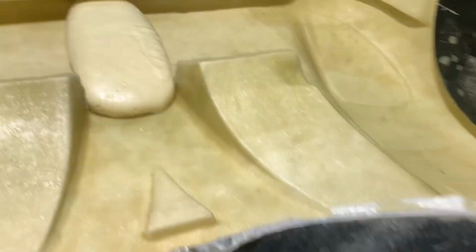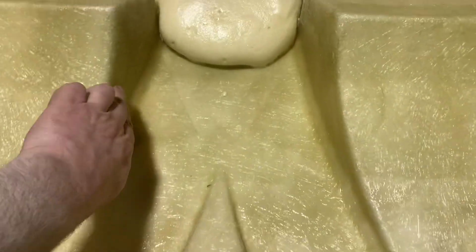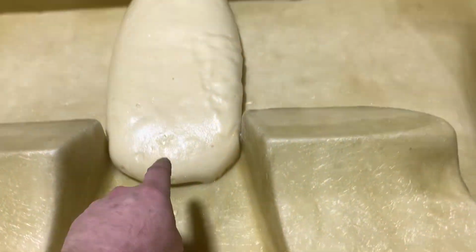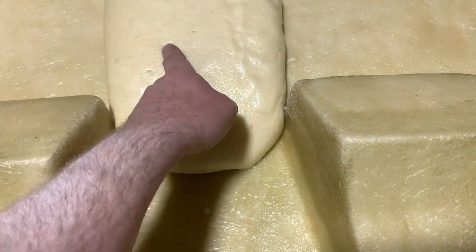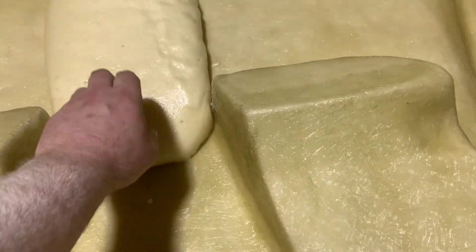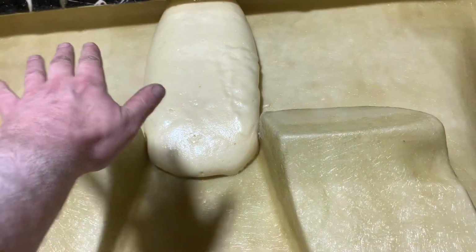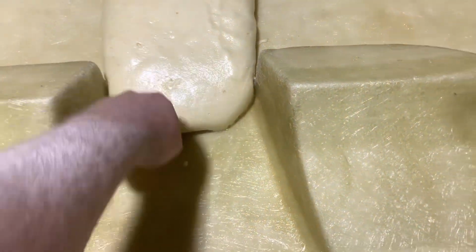Well, unfortunately that tends to put a break in that surface and makes it kind of weaker. So I'll put core mat across there, but I'd have this reduction here. The core mat would have nothing to sit to. So we filled the sort of nose section and that area here. It's almost, actually, I needed to do it about 20 minutes ago. It's already getting pretty close to skinning over. Skinned over. We'll cut that level, so that will be a whole complete surface area there, and we'll just cut this sort of taper down to it.